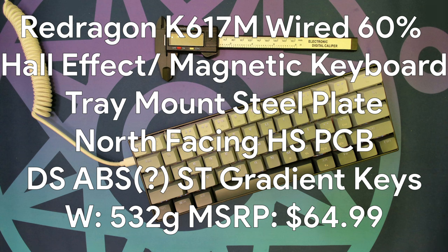This keyboard comes weighing in at 532 grams. The chin sits at 20 millimeters above the typing surface, while the back sits at 25 and a half millimeters, providing for a default typing angle of 5 degrees. Raising the one pair of included feet will take the back height to 32 and a half millimeters and change your angle of typing to 9 degrees.